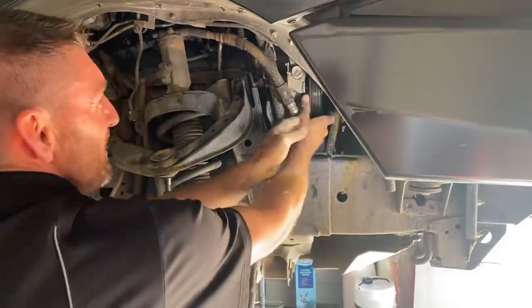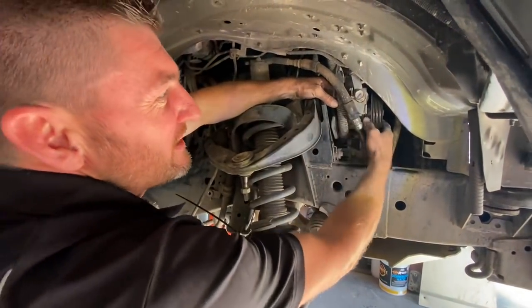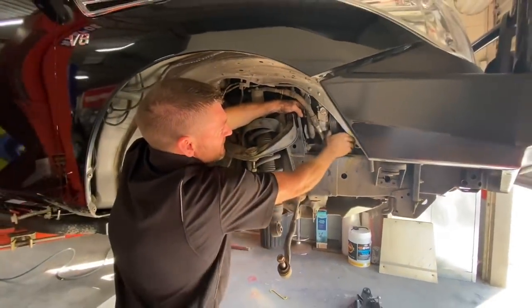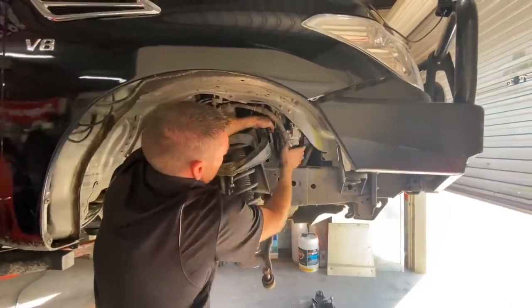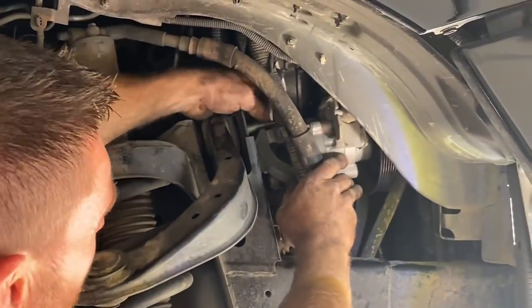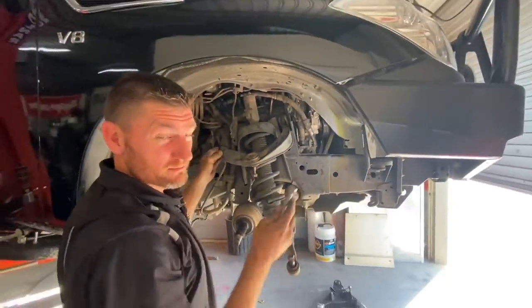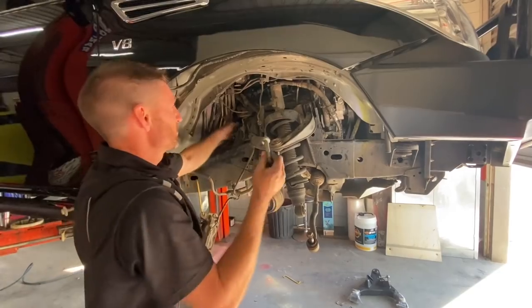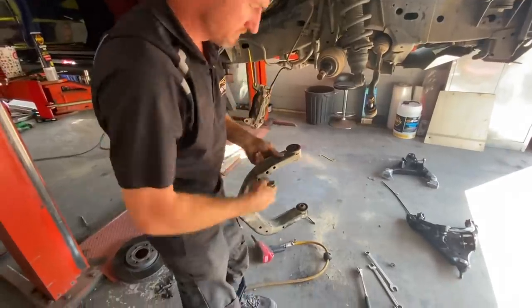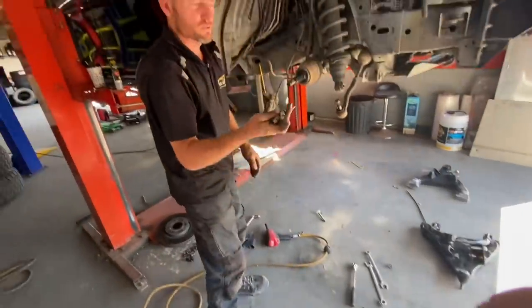In there is a little spacer block that locates the pivot of that power steering pump nice and firm - you just had to rock it out. Now that the pump is loose, move it forward and move the loom out of the way, then undo and get out that silly bolt that interferes with everything. Putting it back together is the reverse process.